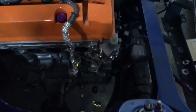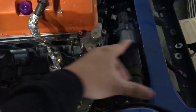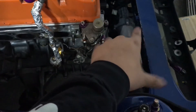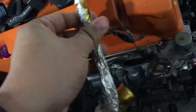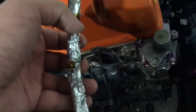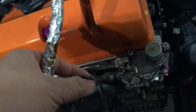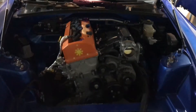That's one of the problems when you're running a front mount manifold, since the pipe runs next to the VTEC solenoid. You need to make sure you wrap it pretty well. I did a foil heat wrap on it and it still got burnt, so that manifold must have been running way too hot.